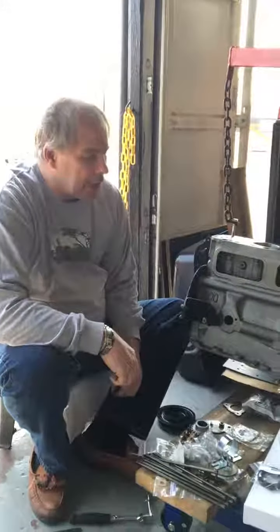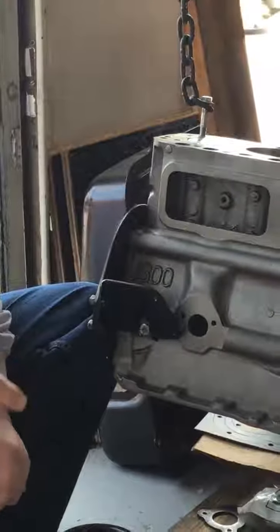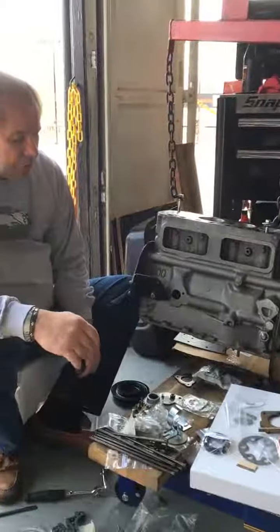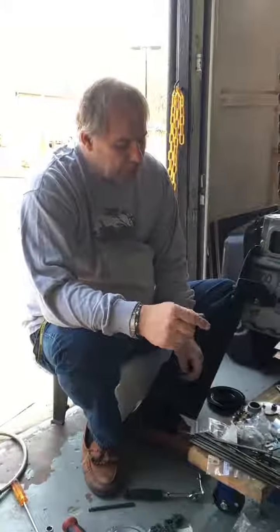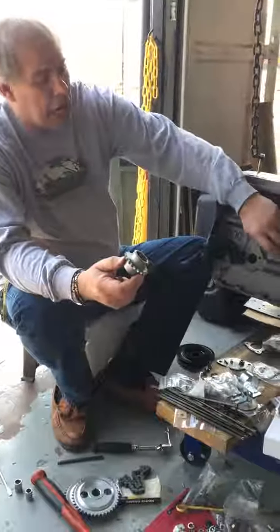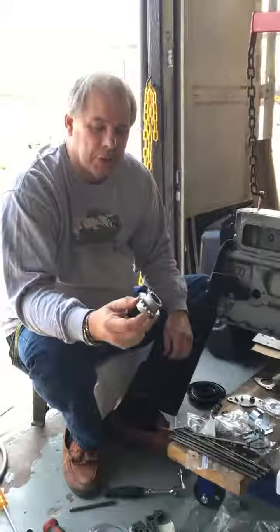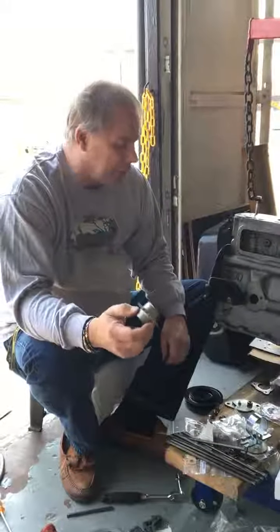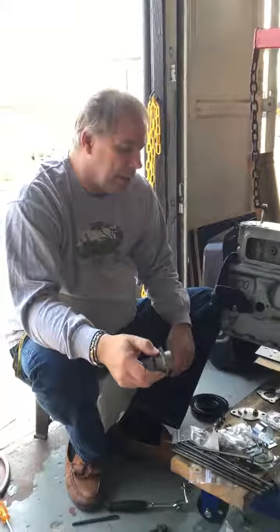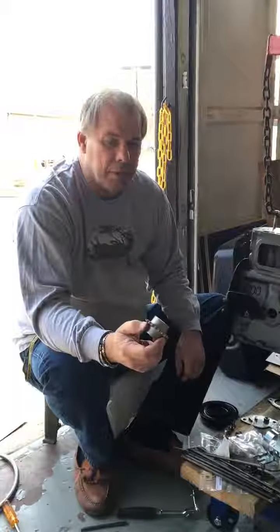This brass stuff is supposed to go towards the camshaft. This is a total engine rebuild — we get new valves, valve guide springs, anything it needs, triple cut, whatever we clean. This is like the original gear. Every part, including this block — this is a casting of the block — I have it blasted absolutely clean. We take all our measurements, which is the proper way of doing it. We may not be the cheapest game in town, but we are one of the most thorough.